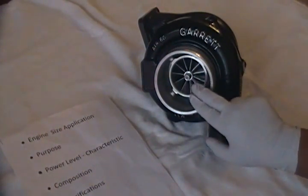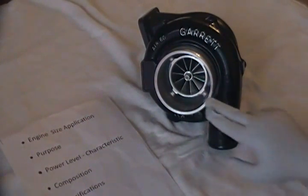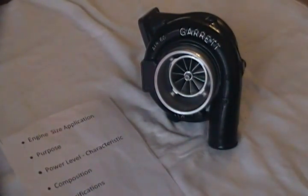One final note — even though compressor maps on this turbocharger from Turbo by Garrett online or other sources will show the compressor wheel is capable of about 600 wheel horsepower at about 63 pounds per minute, that's just the compressor wheel. That does not mean the turbine wheel will allow it to make over 600 wheel horsepower. Don't be fooled by simply looking at the compressor map only — the entire package shows about 560 or so is as good as it's going to get.